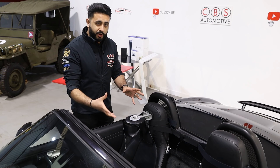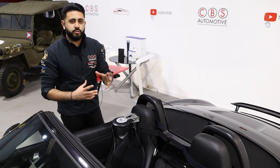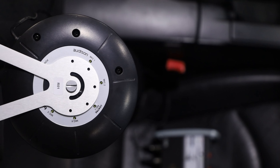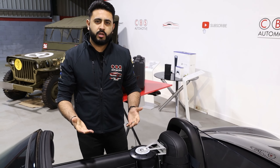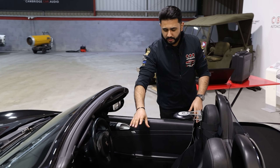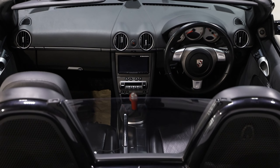We've got lots of microphones in the car. We've got a central microphone just here that's used for time alignment as well as other areas to listen to the car, and then we've got five microphones built in on the driver's side here. The reason why we're listening to the car is because you've got a very uneven area inside — one side has a steering wheel, the handbrake is towards one side of the vehicle — all of this affects sound waves.